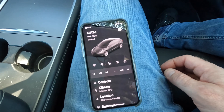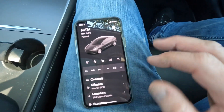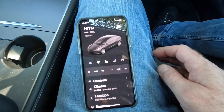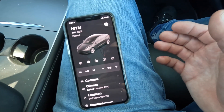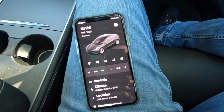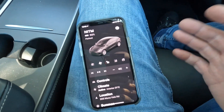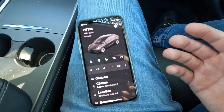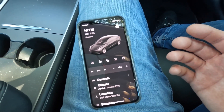There are four different ways to precondition the car. The first way is through the phone app — just turning on the climate controls with the little fan symbol. That will start the climate in the car and start preconditioning the battery and trying to heat that up. You can do that 15 to 20 minutes or half an hour before you depart, depending on the climate, then just go to your car when you're ready. That's the most convenient way — you can do it from anywhere as long as you've got phone reception.